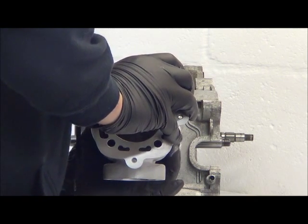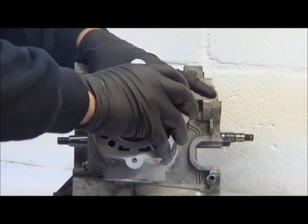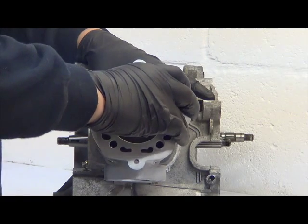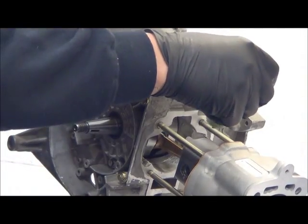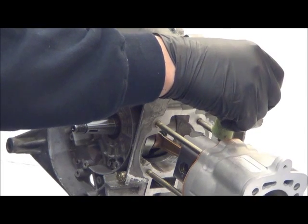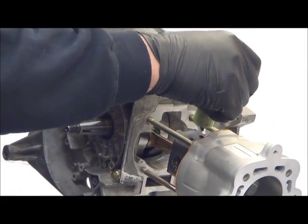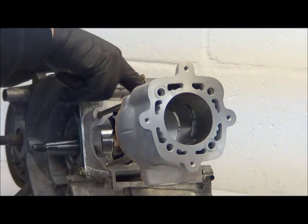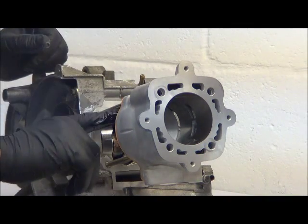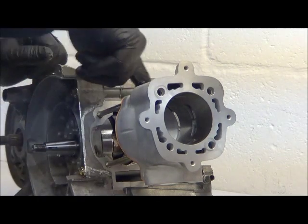Check the bottom main position. Once we have the rings located, we just pull it back a little bit, and that allows us to apply some oil down onto the piston rings. This will run down the sides — a couple of drops all over the piston now. Spread that around the skirt.